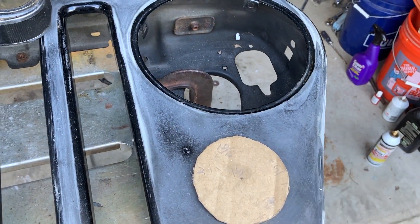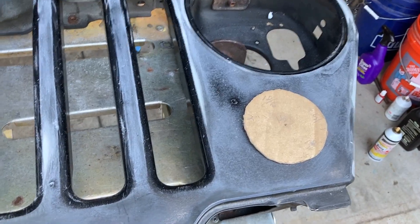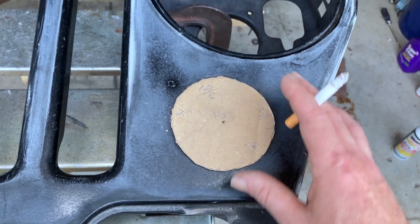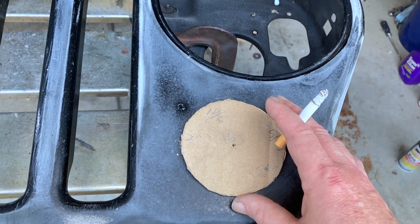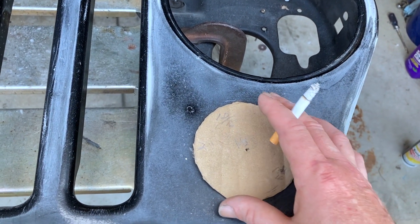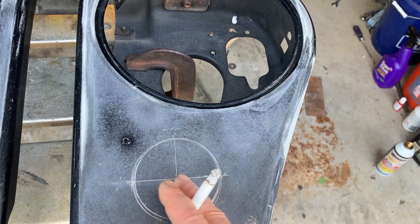How I did this: first I made a three-inch template, laid it down and went back and forth to see where I liked it, then started marking off. I wound up marking at two inches and then five inches. Because of the curved edges, it was tricky to measure — I ended up getting one inch and two sixteenths from the bottom, and one inch two sixteenths from the top. You need to do this yourself using your templates and draw it out.